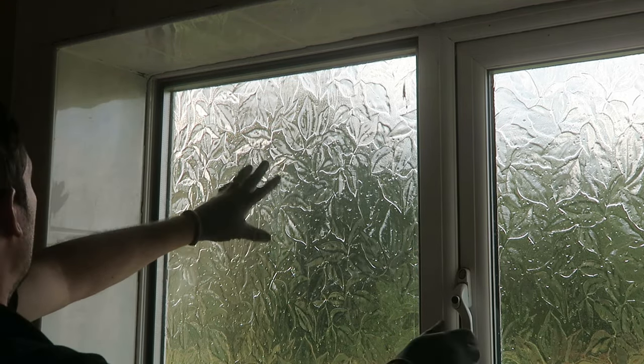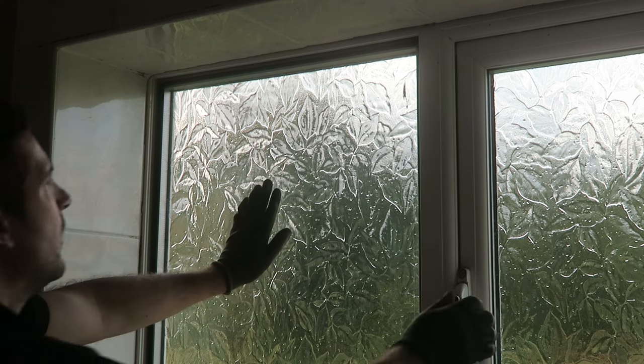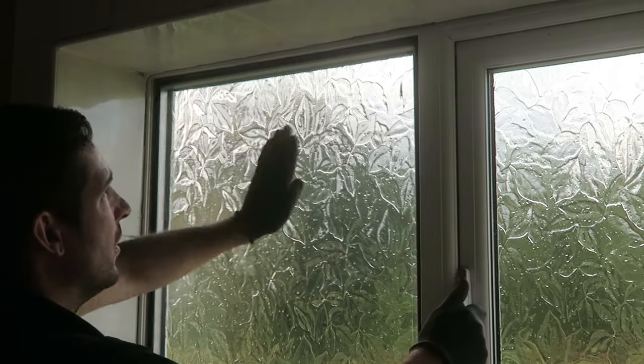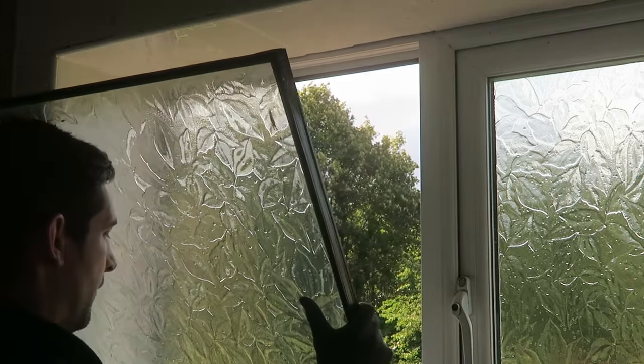Get your hand on the glass now because it's quite free. You can use a knocking motion to get it out — tap, pull it out, and then catch it. And that's how you take glass out of a UPVC window.